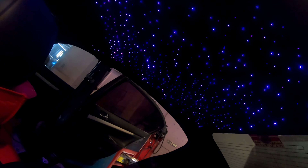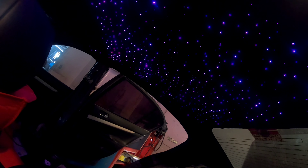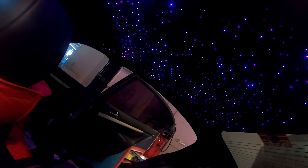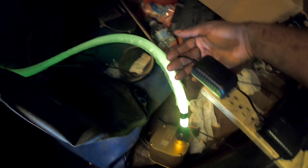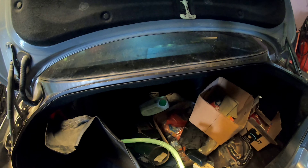Let's go - pink, green. Look at that. You can make them all flicker, you feel me? Turn them all off. So I'm about to show you - got it wired to the back. There's one of the motors, the other one is all the way in there. So there's a negative and a positive in each one. I'm gonna run both of the negatives together and both of the positives together - the negative all the way to the battery negative terminal and the positive into one of the fuses.